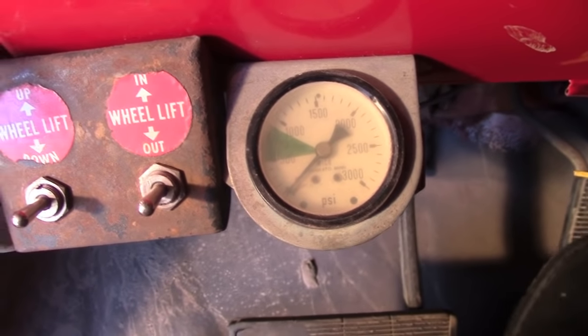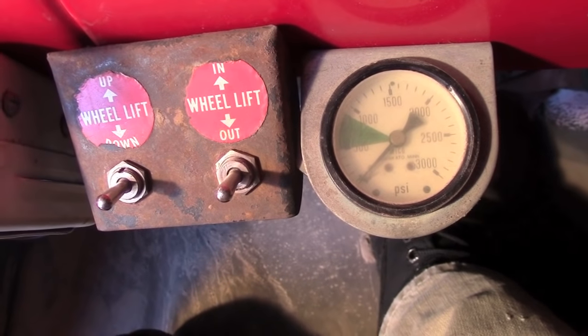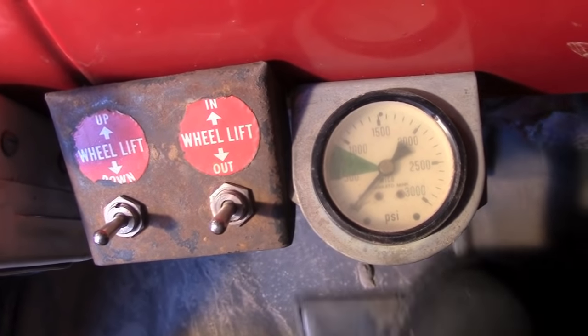Part of the reason I know this is I have a brake pressure gauge in the truck. Let's go take a look. Here's our brake pressure gauge. If you watch when I press on the pedal slow, it doesn't move and the pedal goes right to the floor. And even if I pump the brakes I still can't build any pressure. If there was air in the system, by repeated pumps on the pedal I would be able to build some pressure. So that tells me that my master cylinder has failed - we have to replace it.